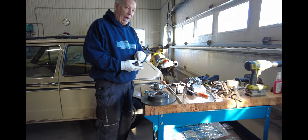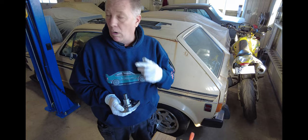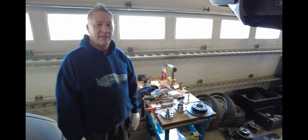The other thing we're really proud of is the material and properties of the stub axle. It's made out of 4140 heat-treated steel, it's nitrided, and it has a limited lifetime warranty. I'll walk you through the process of installing them — it's really easy.